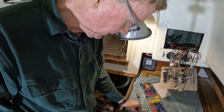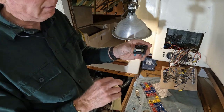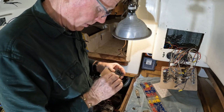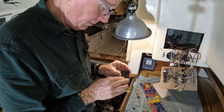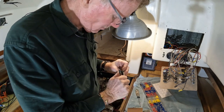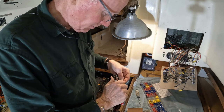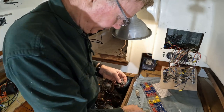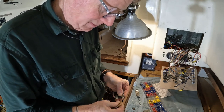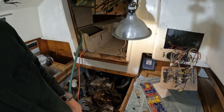Well, surprise, surprise — these two rusty-looking screws came right out and I was able to pull the whole fuse panel and fuse holder out. You can see all the corrosion on these contacts. Unfortunately, my sandpaper got a little bit damp when the water came off the cover. I may have to go down to my workshop and get another piece of sandpaper. This sandpaper is just garbage — it's not wet/dry paper. The sand just comes right off and there's nothing but paper. Okay, down to the shop to get a couple of decent pieces of sandpaper.